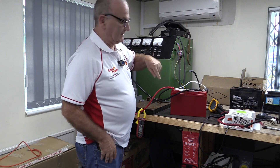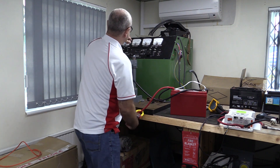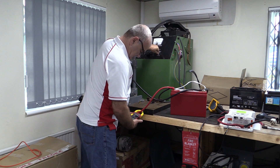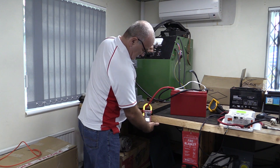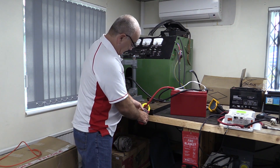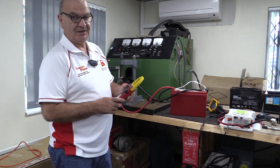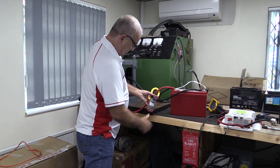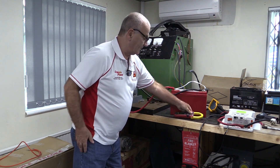What I'm going to do now is artificially load the alternator back up to 100 amps to see how much hotter it'll get. We're loaded to 88.9 amps. Bear in mind when you first fire the alternator up cold, you'll probably get about 110 amps, but when it warms up it'll go to 90. We're back now to 88.6 — it won't do any more than that.